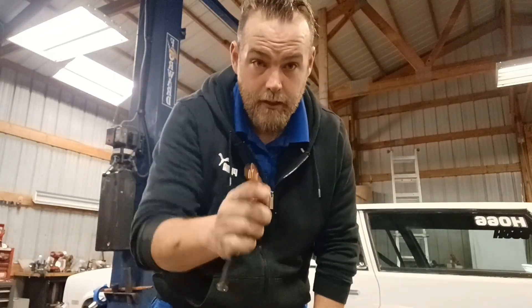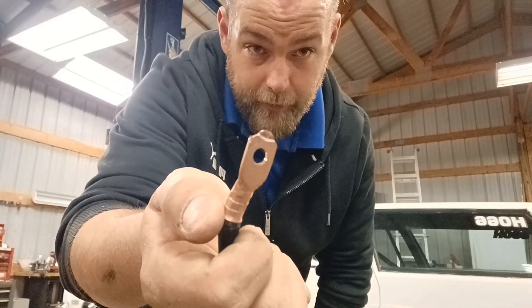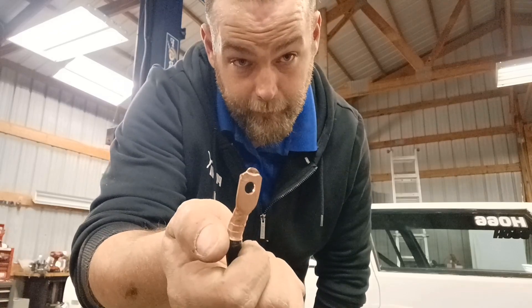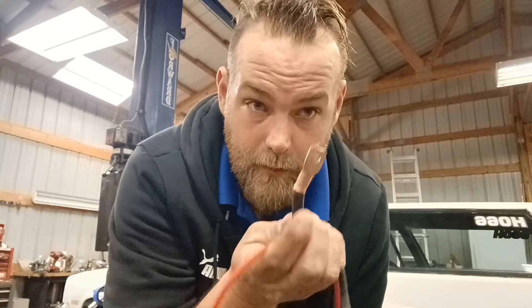As a reference — let's pretend this is the big wire that goes to my starter — all this copper was showing and it grounded out on the bolts holding the starter together. Not knowing that, we thought the wiring was wrong. I put a little one-watt test light bulb that lit up on the deadest battery chilling by the fridge, and it did not light up on my battery, so my battery got cooked. Amazed it didn't just ignite. Anyway, got a new battery in, found the ground, fixed it, wrapped it with electrical tape, got it sorted.